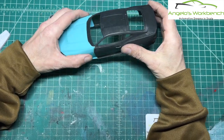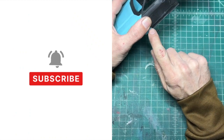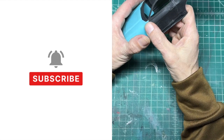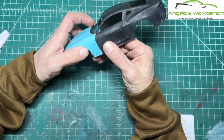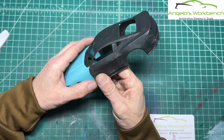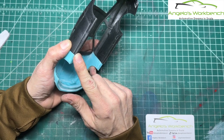My plan for this — the seam is right on the door seam, so that's perfect. The only thing is there will be some body puttying down here because obviously this is not a door seam below this point, but from here up is the door seam, so that should be fine — it won't need any putty. It's a really smart way to do it; the way he sliced this body along the door line was a good call. You're just left with a little bit of putty down here, and that'll look great.